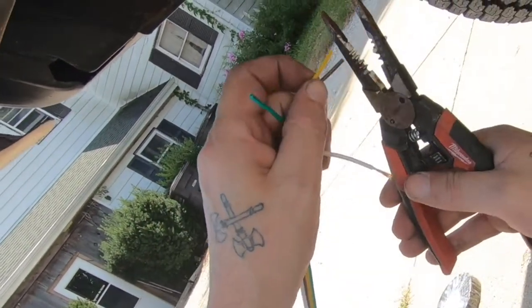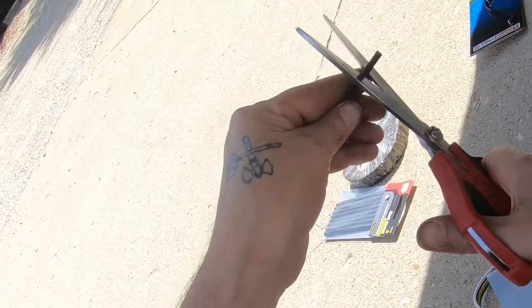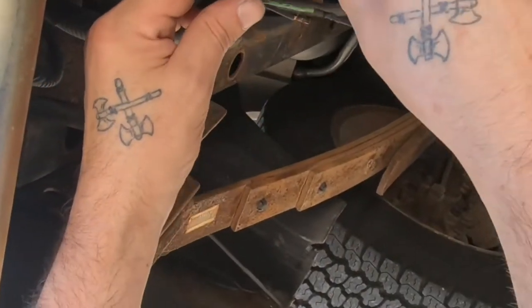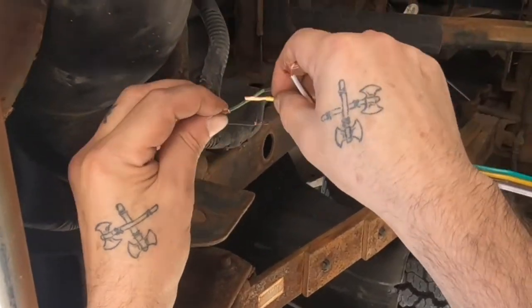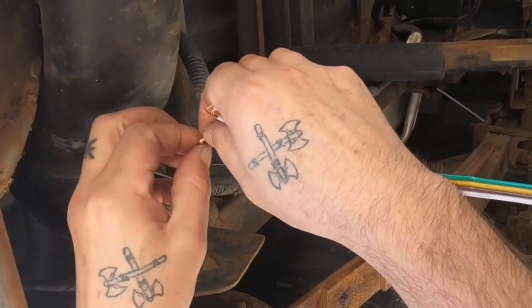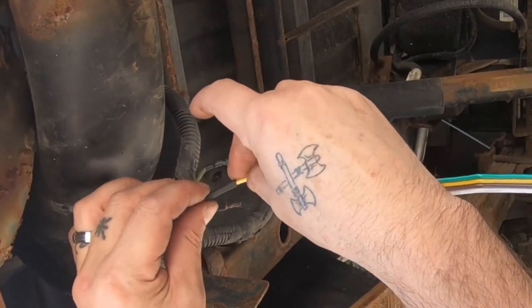On your four-way connector, cut off the part with the amount of slack that you need. I'm cutting off a little piece of shrink wrap for the wire and I'm just going to use a lighter — you can use a hair dryer or a heat gun. If you do use a lighter, be careful so you don't burn the coating off your main wires. Just go around it carefully and you'll see how it shrinks right to it. It's really easy.